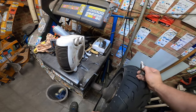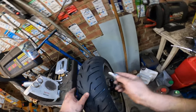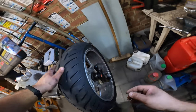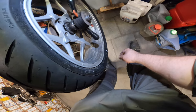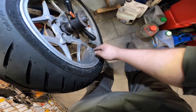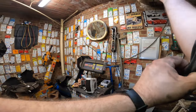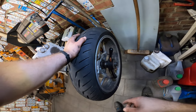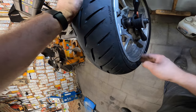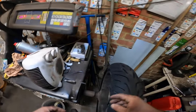So, where is the 10? Over here, so that's right over here on the right side. And what do we have there? 15 grams. So I'm gonna install 10 grams. And next time, because we're gonna create too much of a weight thing on the rim, we'll take off all the weights and do it fresh. All right, with a virginized rim, if that's the thing.